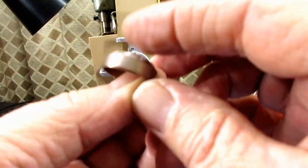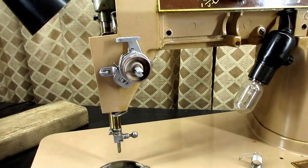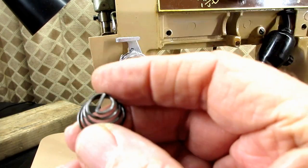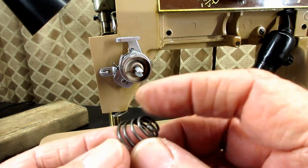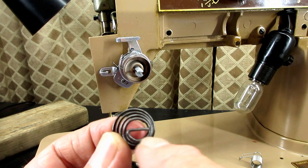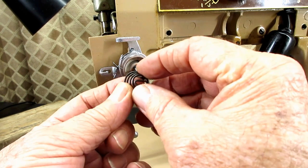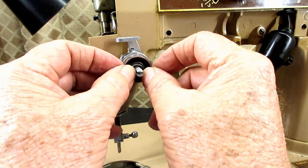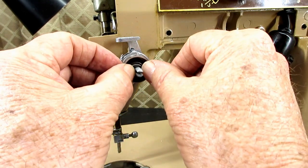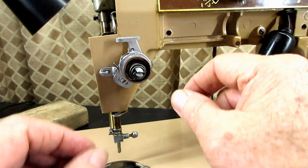Make sure my spring is back in there all the way. I'm going to put my indicator plate on with my plus sign up. See, that's what's going to hold the thread guard and spring and all those discs in there. Now I put my little beehive spring — see how that front coil only goes halfway around and cuts across? That's so that part that cuts across can go into the slot. I usually put the half coil on the bottom. That is made so the spring doesn't just twist around. Then I put the beehive spring tail or cross arm into the slot to keep it from spinning.